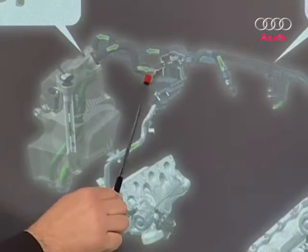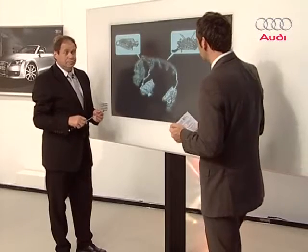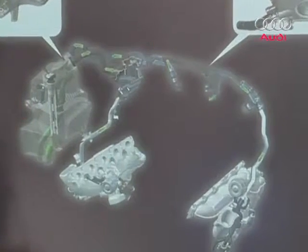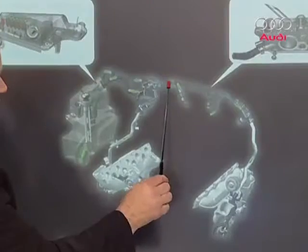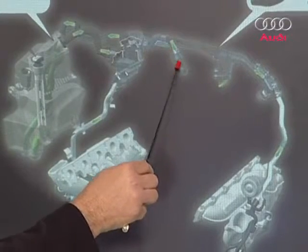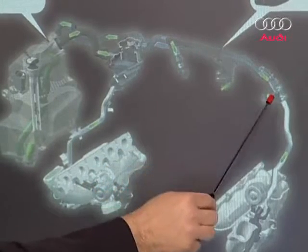These gases are fed in differently depending on how the engine is running. Let's assume it's idling in neutral or in part throttle — there's a vacuum in the intake manifold, so the blow-by gases are fed directly into the intake manifold. We've built in a non-return valve so the gases can be extracted into the intake manifold. On the intake end of the turbocharger there's a non-return valve on the extension axis and on the inside too, so those valves are closed when the intake end is pressurized and the blow-by gases go into the intake manifold via this open path.